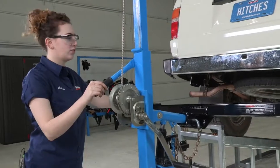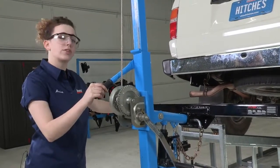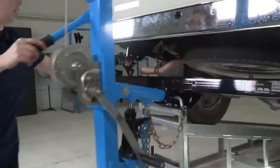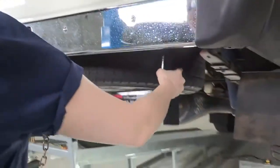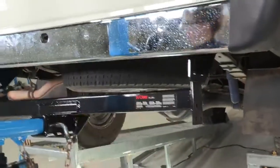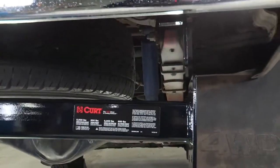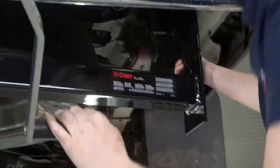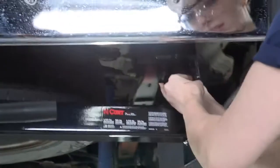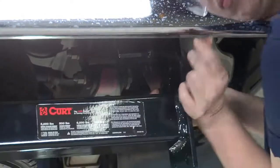Next we're going to put the cross tube in. We're going to be using our U-Haul exclusive hitch jack to position this cross tube between the two brackets we just placed. If you're doing this at home, I recommend just having a friend help you so you don't hurt yourself. We're going to go ahead and get it between those two brackets here — raise it up just a little, make sure we get it on the inside of those brackets. This is why we haven't tightened anything down yet — we need just a little bit of room to get that hitch in place around those brackets. I'm kind of having to hold this in place just to slip that through into the inner side.